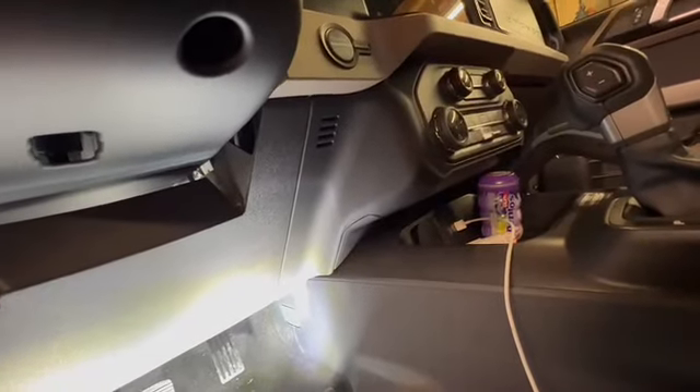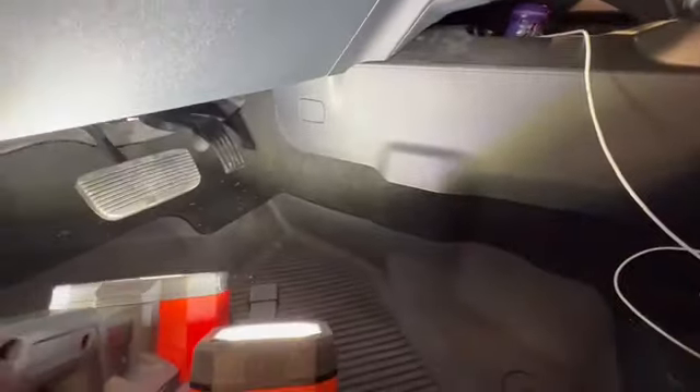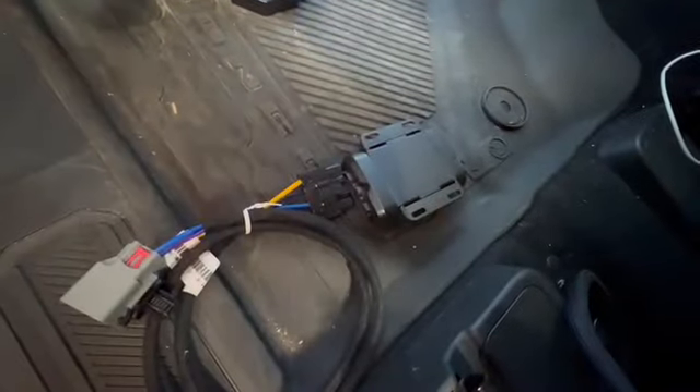I'm gonna find a place to sticky it somewhere, then run that cable for the brake controller. I'm surprised they don't put it up here or something. Here's the actual brake — see that little plug right there that's empty? That's your plug for the brake controller. It's plug and play. Here's your female connector, and this just plugs right up into that.